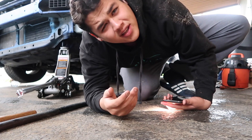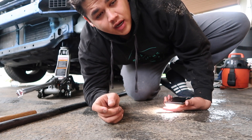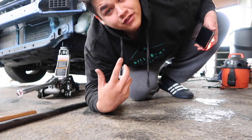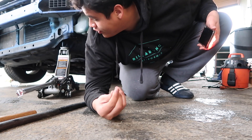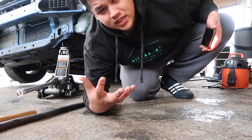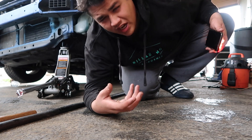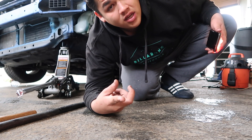It's not bent, so we're gonna take the wheel off. I'm going to set it back down a little bit to get the wheel off and then lift it back up. I have a feeling it's going to be a pain because I don't have turntables to make the wheels turn easily, and you're supposed to align the toe with the car's weight on the floor. It's a lowered Del Sol, so I think I'm just going to adjust it while it's in the air and hope for the best.